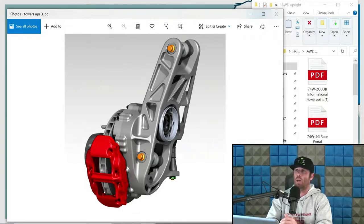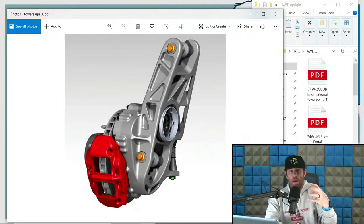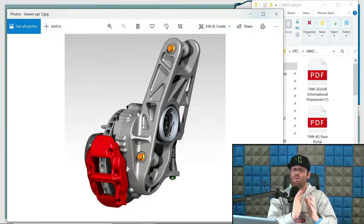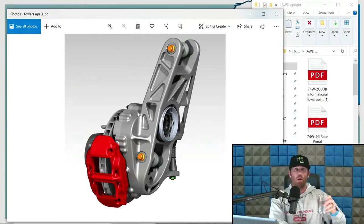And what this does is it mitigates CV walkout. What that means is as the CV is further away from inclination, whether it is inboard or outboard of it, the CV, as the upright rotates, what happens is the center point of the CV tends to walk side to side a little bit, and that walking effect will actually add to plunge, and not in a good way. And you may have to try and mitigate that plunge through other characteristics, etc. Whereas you can line up, if you can, with the parameters you're given, line up appropriately the CV center point on the upright, you're going to minimize that walkout, and you're going to effectively help you get to a better plunge number for the system.